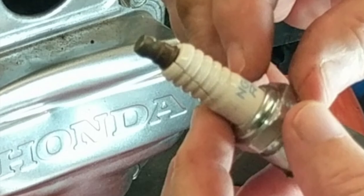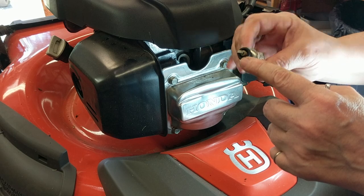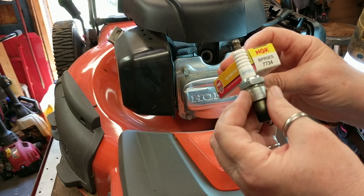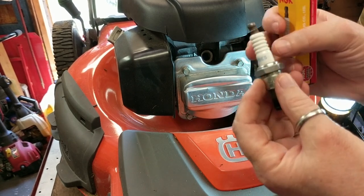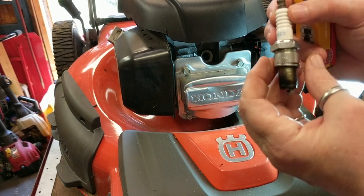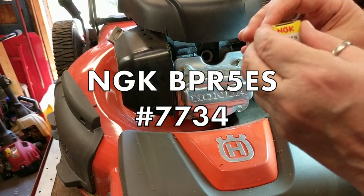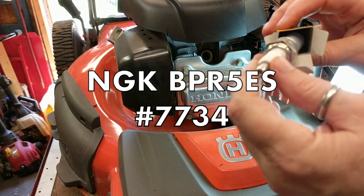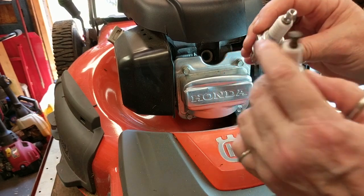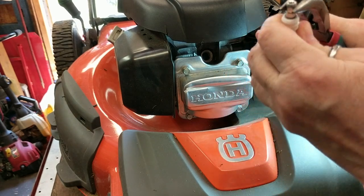I'm shocked that she was actually able to use this, but it was running pretty good. A nice chocolate brown color is a good place to be. We're going to be replacing this with the same plug — it's an NGK BPR-5ES. You can actually see the ceramic is cracked on both sides — I'm shocked this thing even ran. Here's the new plug. One thing to note: this particular style has a removable cap, unlike the old plug. Just make sure that cap is tight — double check with a pair of pliers.